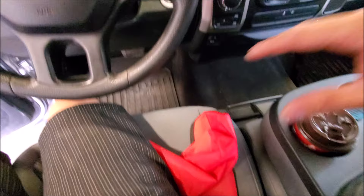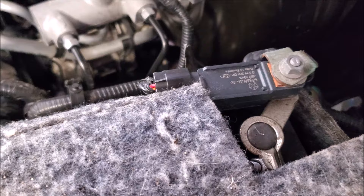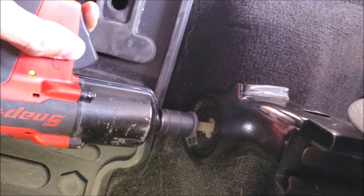This RAM is relatively well-featured — it's got the bigger screen, cloth seats, but power everything. The customer wants a little more comfort, so we're going to put heated seats in to make those mornings more comfortable. First thing we're going to do is disconnect the negative terminal on the battery. Next, we have to unbolt the seats. Then we can disconnect any wire harnesses and start to release the seat material.